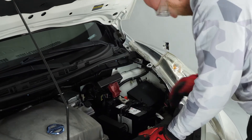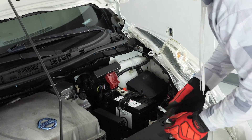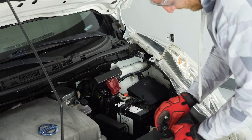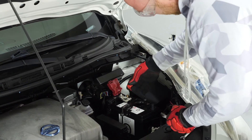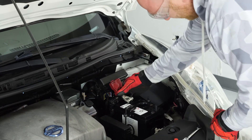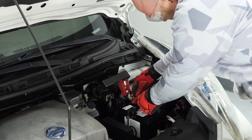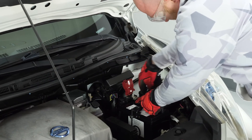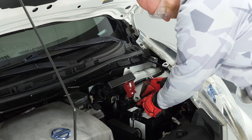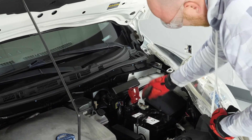Now that you've got the battery secured and not sliding, you can start making the connections. You'll need to use the spacers that we've provided — they're JIS to SAE adapters, which is a fancy way of saying they make the terminal go from smaller to bigger. Take the larger of the two spacers, slide it on, and push it down so it's flush with the top. Then your positive terminal is going to connect there — snug it down before you get to the negative, so you can leave the cap on the negative and avoid risking a short across the terminals.